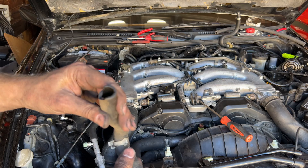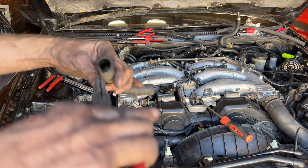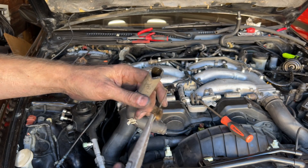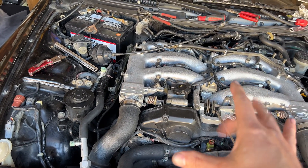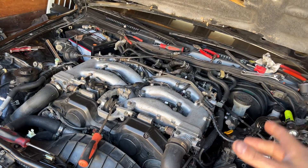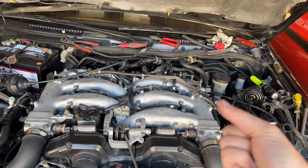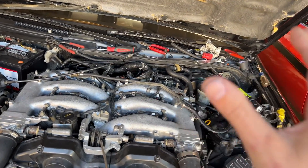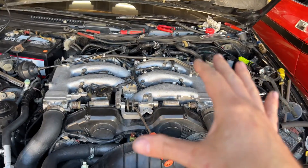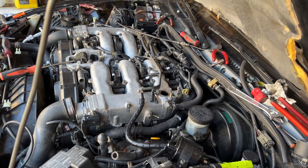Well, I broke an EGR tube - this rubber is just like, it's not rubber anymore, totally crunchy, turned into plastic. But check out what I found - it's like a pipe cleaner. So weird, I have no idea why that was in there. I've got to say, this thing is really kicking my butt. I really underestimated how many tubes, wires, and all this stuff is connected to it. I'm spending hours getting to these little random clips holding hoses on the back of the intake manifold. It's really just old cracked dry rubber hoses, which is part of the experience as these 90s cars age.